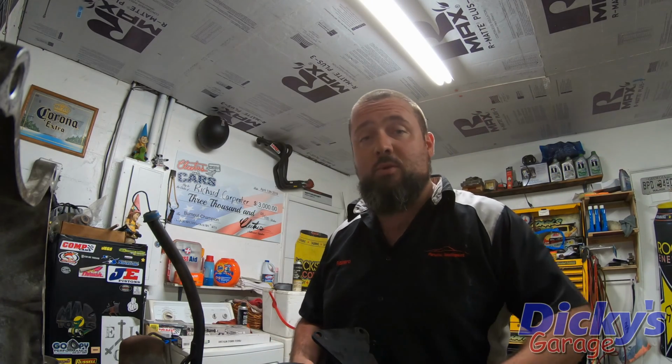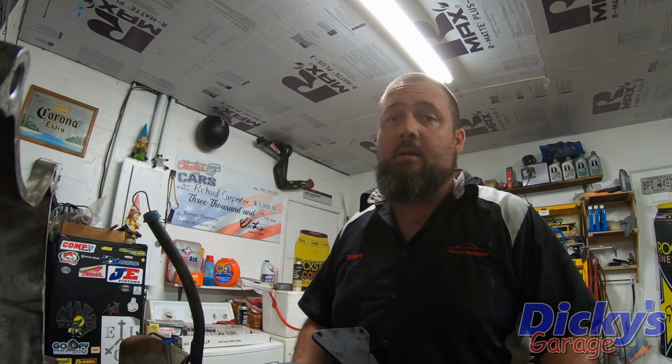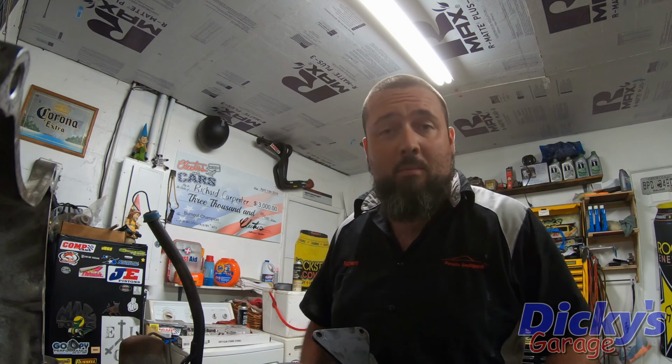Let's get back to Project Ethel, and more importantly, let me show you guys why I decided not to weld the differential. So last week when I took the differential cover off our final drive on our TH425, I stuck the axle stubs in there and just tried to see if I could turn them opposing directions, and I could. So I assumed I had a set of hypoid spider gears in there that just needed a quick little burn with the MIG welder to make posi. Turns out I couldn't have been more wrong.